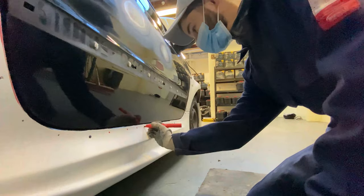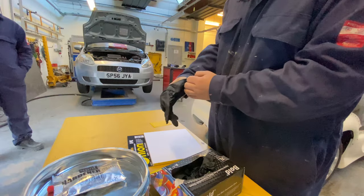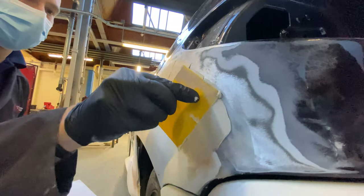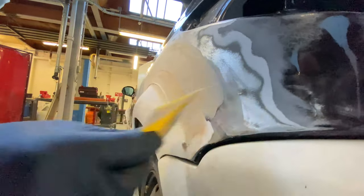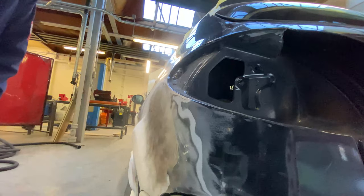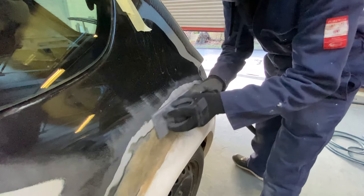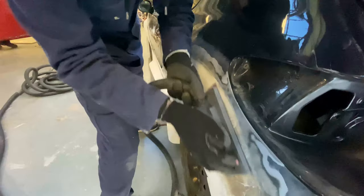It's a fibreglass kit on the sides and the sills. As part of the trial fitment we have to screw the side panels on. We shave any corners off and fit it back on with a sealer, which is a polyurethane one-pack sealer. Any excess sealer is taken off, cleaned off, and then we flush the body kit in with various body fillers.